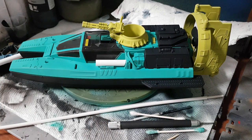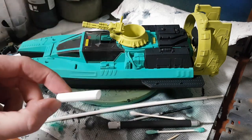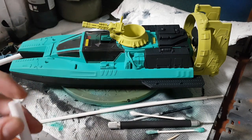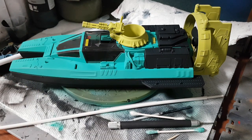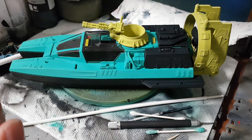It is recommended to pre-paint this — build it in place as you go, and once the glue is dry it's definitely recommended to paint it separate from the vehicle itself so you can make sure you have proper coverage. So there's the first section — let's get the second section going at 9/32nds.